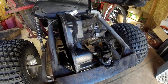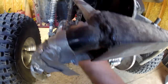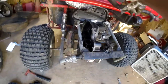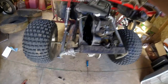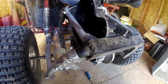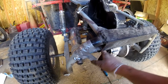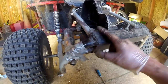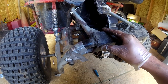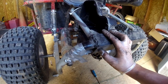All tightened up now. I did a little bit of tapping on the clutch here because it seems like it's just not free spinning as much as it's supposed to. If you push it forward, it's like we're fighting the compression of the engine — it's actually stroking. I wonder if with the ignition on it this thing would start; I wonder if you can push start it now. The only real way to fix that would be to take the clutch off, but it still is working, so I might just go ahead and throw it all back together and ride it around a little bit. I still have to fix the battery plate and relocate it. I think we'll just ride it until it yeets itself and then deal with it.